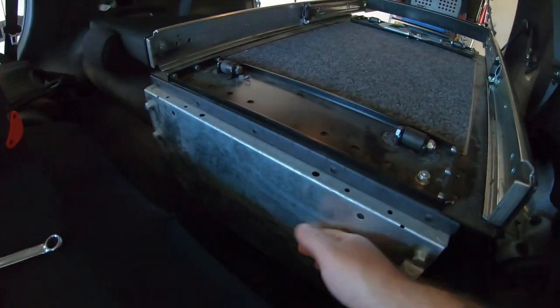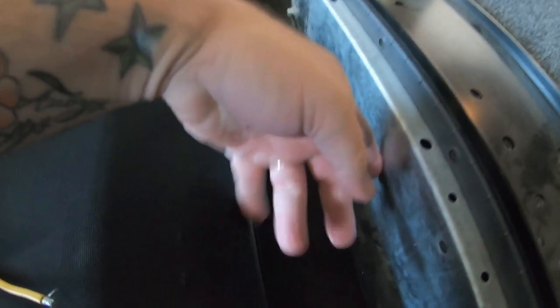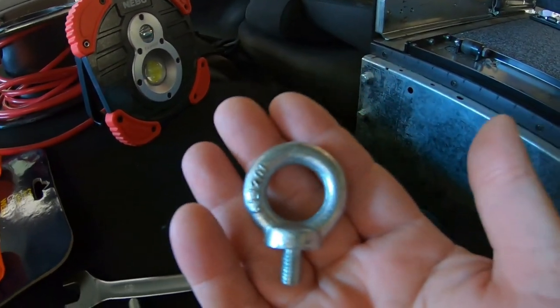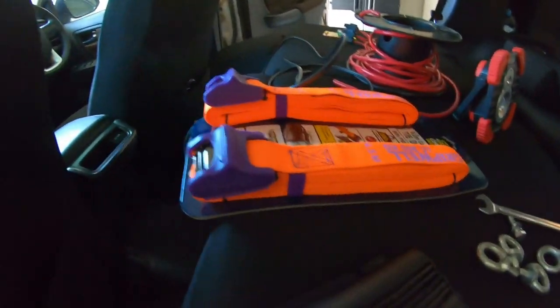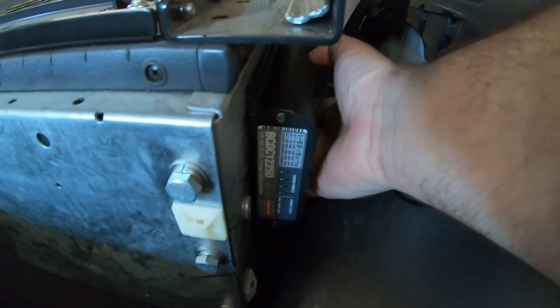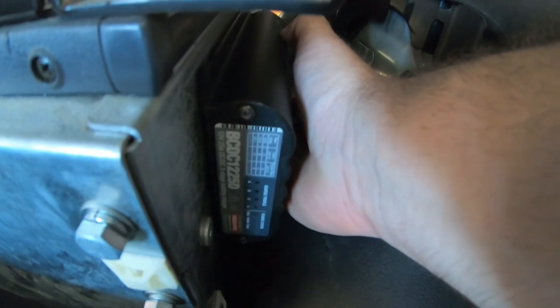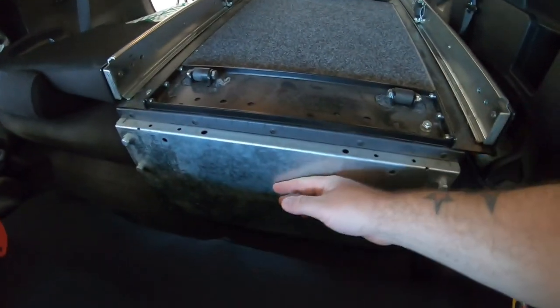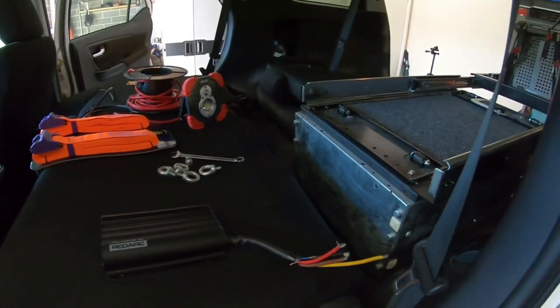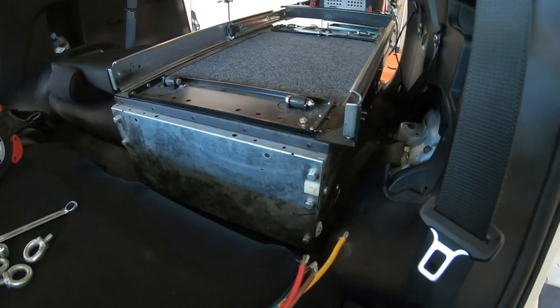In the back of the car — back of the drawer, fridge is just extended out. The battery is gonna sit in here. I'll just sit it down on the floor and then I'll strap it and secure it to the back of the drawer. We've got a heap of high tensile bolts which lock this back panel into place. I went down to the bolt shop and got a couple of eye bolts — I'll take some high tensile bolts out and put these eye bolts in, then use these straps to hold the battery in place. It is important to secure it because it's bloody heavy — about 30 kilos. The BCDC charger is gonna mount just down there in behind the drawer so you can still see all the lights. I've got some earth points there which I'm gonna earth straight to the chassis. The battery will sit here, one port there, one port around here for the fridge, then another port up there — so it's gonna need minimal wiring. The longest wire will be the wire to the BCDC from the front — everything else is in close proximity to the battery.